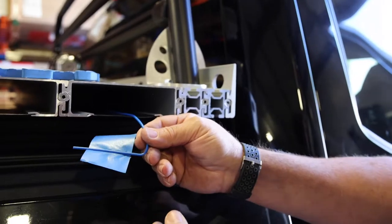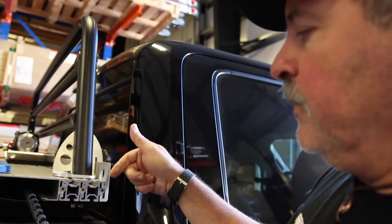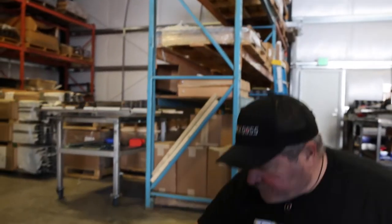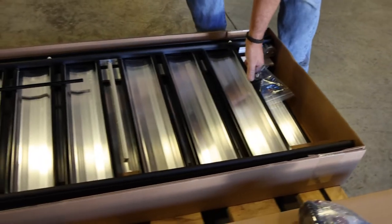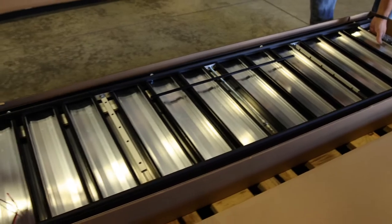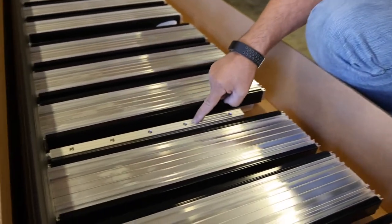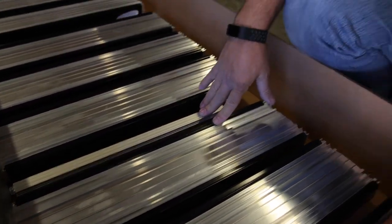There's a pull wire here that gets power to both the rear and front lights on the expandable deck. Pull these out and tape it to the deck. We're ready to install the sides. Pick up the right side — the passenger side — first and lay it up onto the truck. When unpackaging the box, note that there are holes on the bottom side of this piece — they should be facing down, smooth on top. Also, this is a snowmobile deck, so we need to install the carbide protection kit on the sides before they get installed onto the pickup.